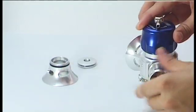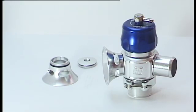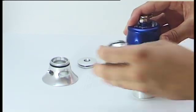But if you're after a purely recirculating blow-off valve, then the plumbback port is the best choice for you. Just take out the trumpet and screw in the provided blanking plug.